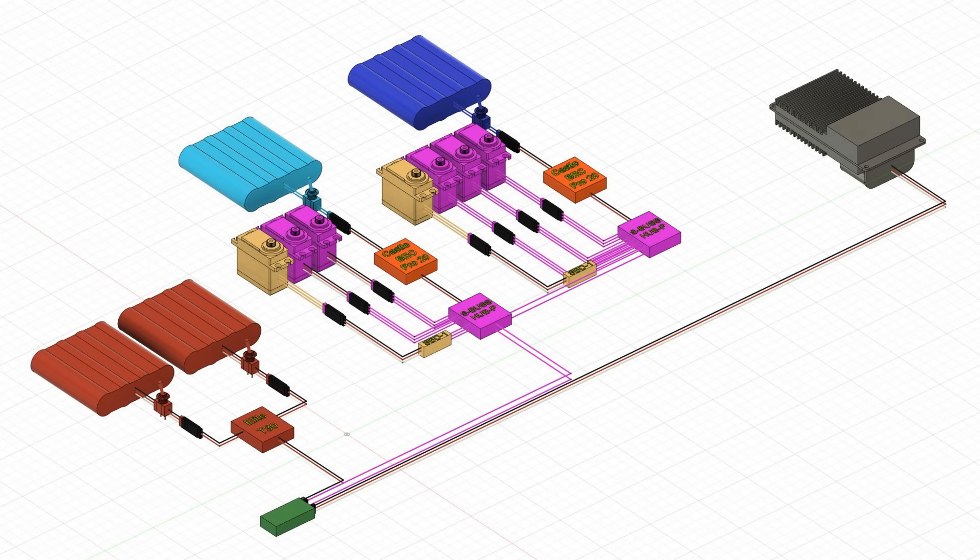There was no BEC on this ESC, so I didn't need to remove the red wire like you would with a BEC ESC when using separate radio batteries. If I had removed that red wire, I don't think my plane would have crashed — unless the negative and signal wires melting together still took out the signal to my receiver. Basically the ESC fire was so bad it dead-shorted those wires and took out my receiver. Back in the day we always had two receivers in big airplanes, but everybody thought as long as you have two batteries and a device to pick the best battery, you only need one receiver. On big electrics, I'm never going to do that again.